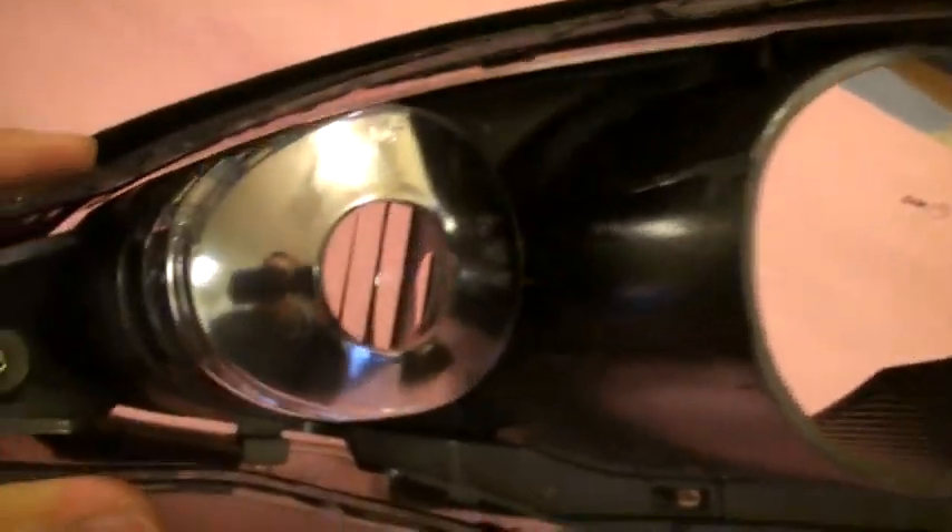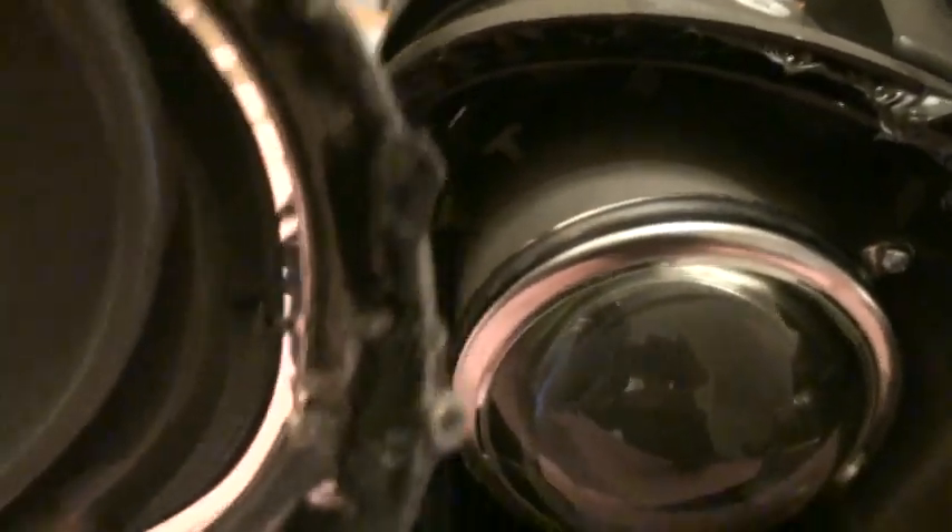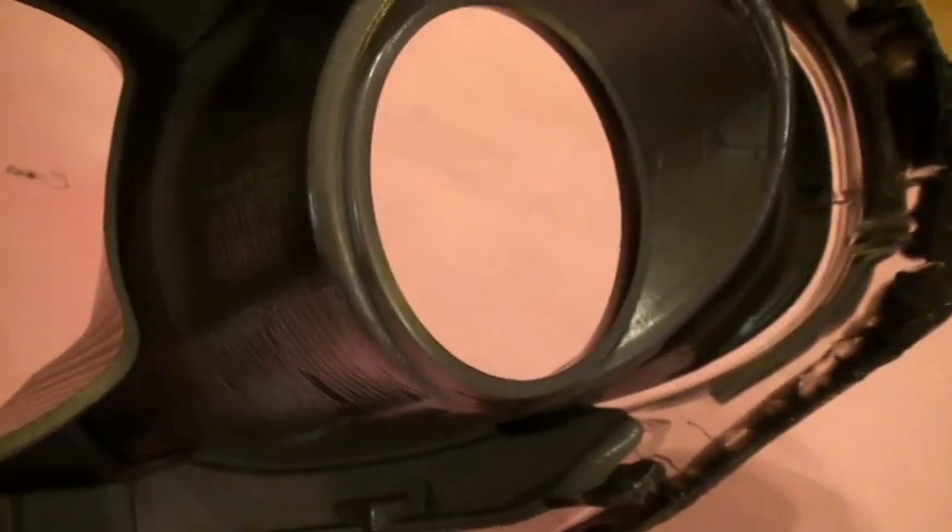This interior piece right here is held in by really only one single point at the edge — there's a Phillips head screw. On the second edge there's a little nub. You probably won't see it too well, but you will when you actually take it out. You can just stretch the edge of the plastic and snap it out. At the bottom there's a little guide tab — it's not a snap tab, so it'll just pull out, and some of the sticky stuff may stick on this interior housing. Besides the screw and this little nub and peg, that's pretty much all that's holding it.